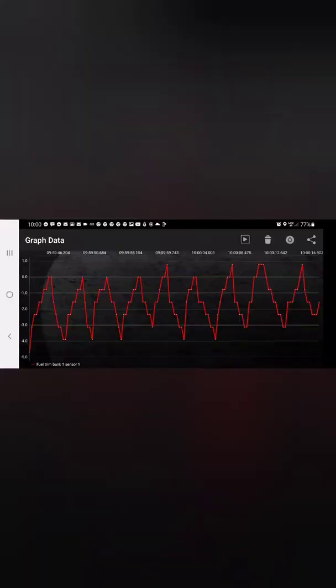Well, it seemed to be a success. So we cleared the codes out, fired the vehicle back up, and ran the short-term fuel trims on it. Before, when I checked the fuel trims on this, it was plus or minus 10. And to be in spec, plus or minus 5 is where you want to be. Ten points total, not one way or the other, so minus 5, plus 5, somewhere in that area is about where you want to be. So, like I say, it was plus or minus 10. Now we are somewhere around plus or minus 5, which is perfect for where we need to be on this vehicle.